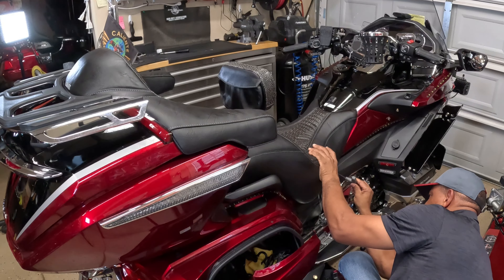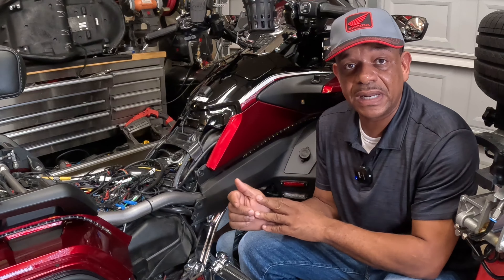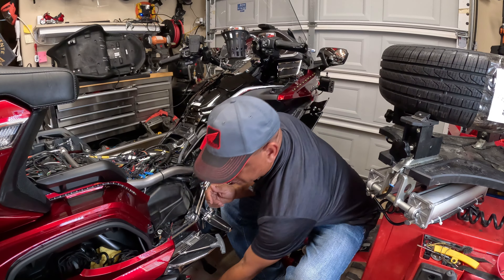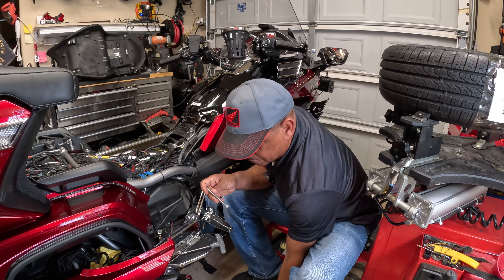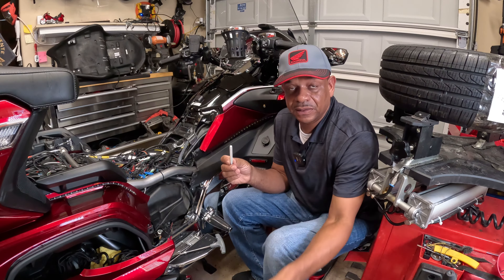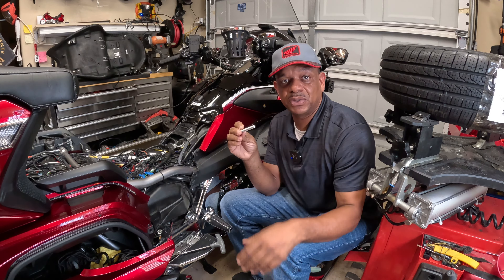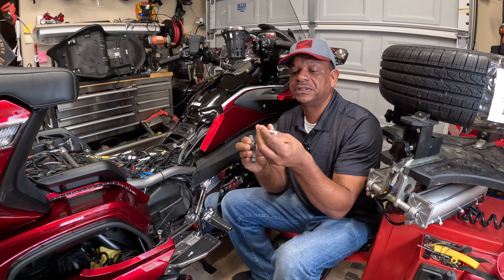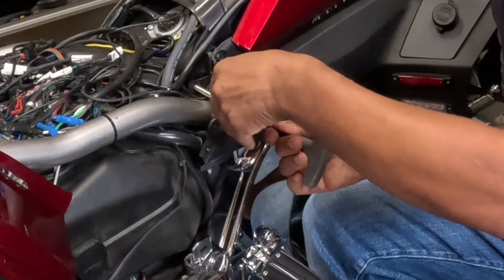For some reason, I'm not sure why Honda didn't tap those bolts all the way through. So if you have a problem putting your seat back on because your bolt will not go through, I'm going to show you a couple of things you could actually try. One of the first things I like to try is to take a little bit of oil and put it on a brand new bolt. This bolt size is M8 and the pitch is 1.25. A lot of times you can take a brand new bolt and try to feed it through, and sometimes that works.